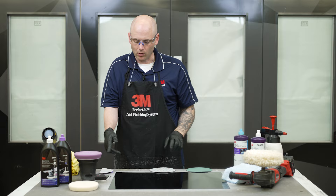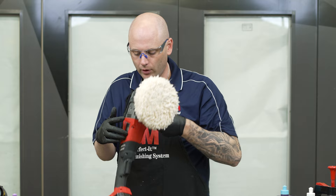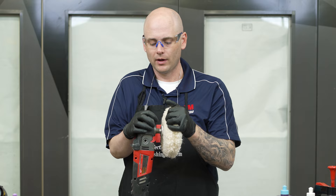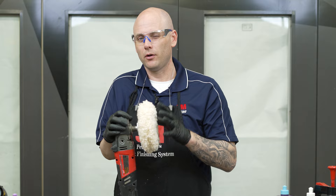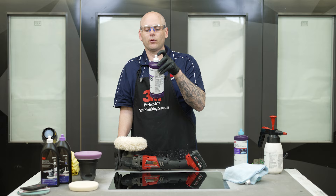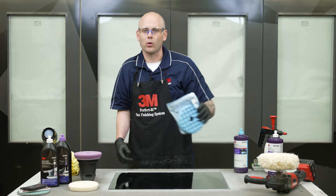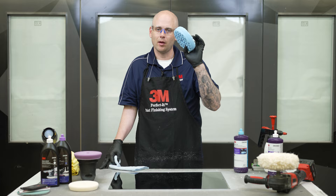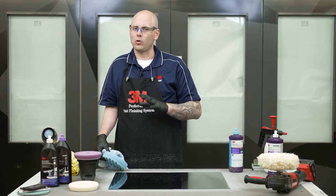Now moving into the actual polishing itself — a lot of shops are still using rotary type buffing systems from compounding all the way through the polishing stage. These are really good for speed, but the downside is they tend to leave swirl marks. Make sure you're using clean pads and cleaning the tops of your bottles so no dried compound falls into the wool and leaves deeper scratches. When working on darker vehicles with a rotary system, you'll need to add one extra step — typically using a blue foam pad, which is very soft, along with an ultra fine machine polish to get rid of any swirl marks left behind.